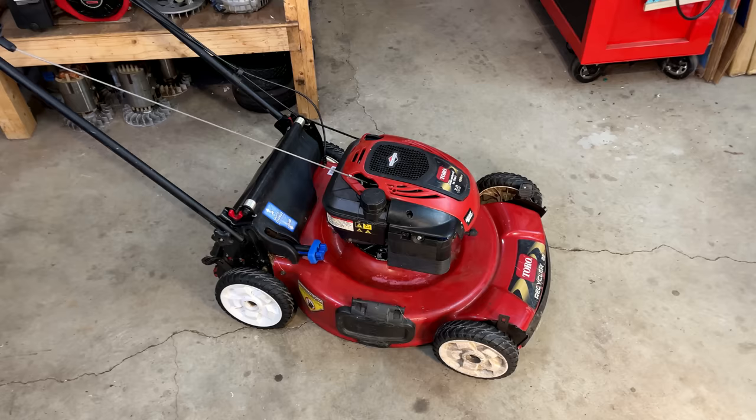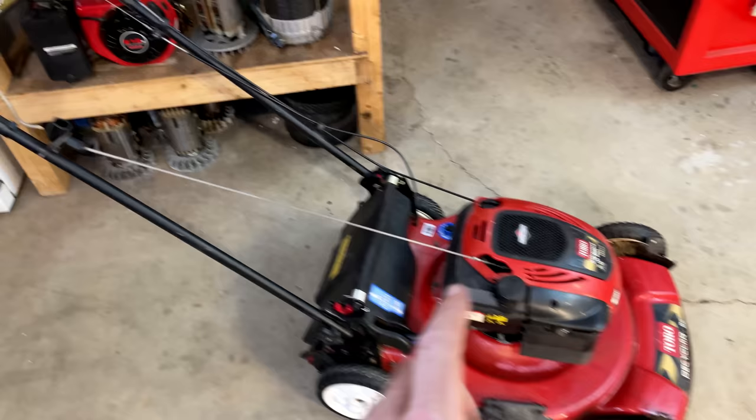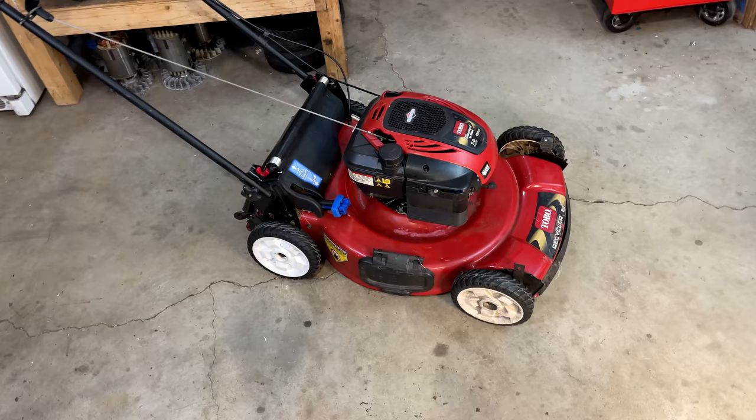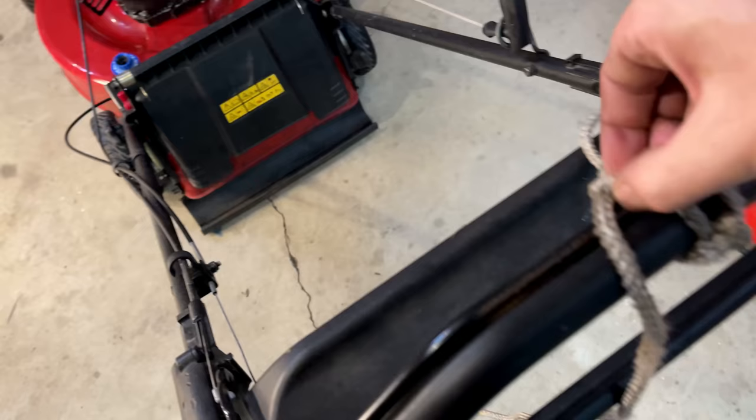But before I do that, there's a new issue that did not exist last year. When I went to shut it down, I let go of the bale and I saw sparks coming from the brake. The engine bogged slightly, but it kept on running. So the kill wire, the kill switch, wasn't being engaged. So I had to tie the bale off and just pull the wire off the plug to kill the engine. So I think I'm going to look into that issue first before I bring it outside.